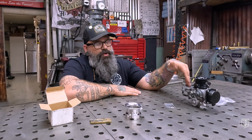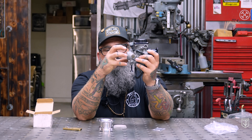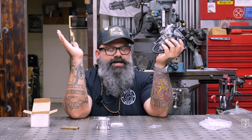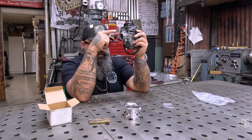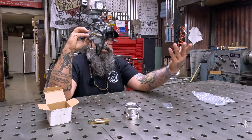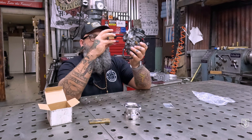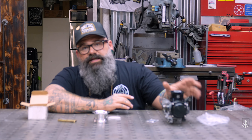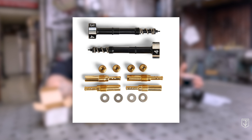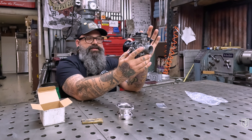We offer performance tuning kits as well as performance rebuild kits. A velocity stack is a performance upgrade, so you want the correct jets designed to work with it. These Honda Shadows are 20-plus years old — what you pull off the bike is likely not going to go back on the same way. The carb boot — a rubber boot on the back side that attaches to your intake manifold — is probably toast. If you've never touched the carb, do not skip: get a new intake boot. We sell them on shop.tjbc.com. That rubber is so hard and formed that when you pull the carb, it won't go back to shape, so you'll have air leaks. Definitely replace the intake boot and definitely tune if you get a velocity stack.